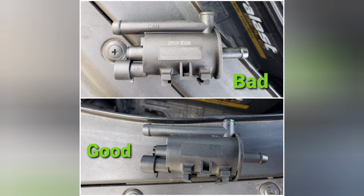Okay, sorry the video ended so shortly. What I had to do was just go out and get a new vapor canister purge solenoid. The top one I purchased first was faulty. The bottom one looks old, but it wound up being a pretty good one. So that was what was causing the noise you were hearing. So everything worked out, and I'm good to go. If you need part numbers or have any comments, please comment below.